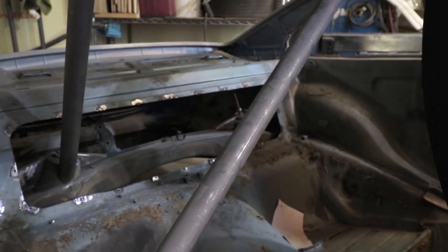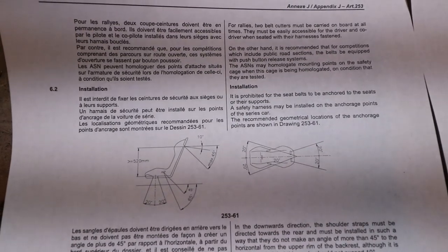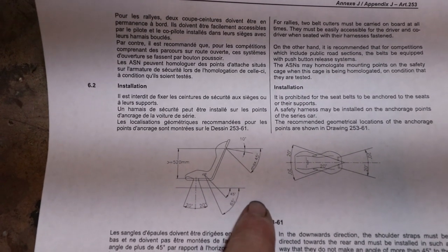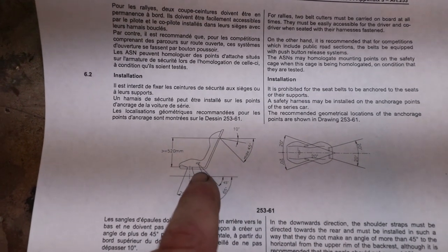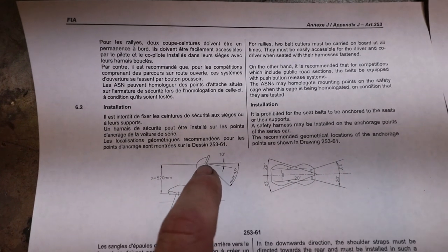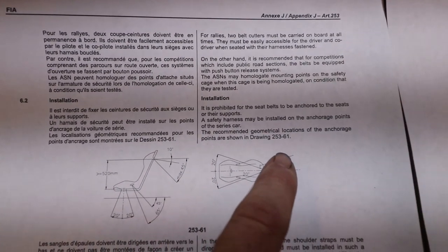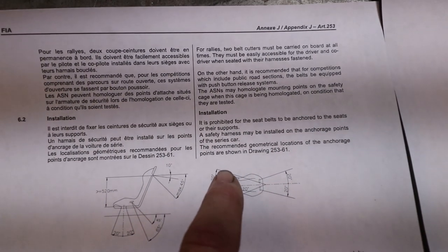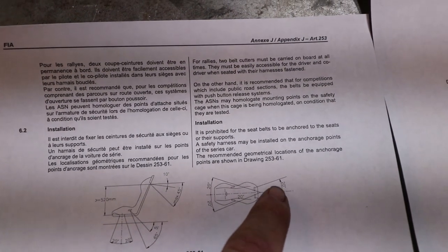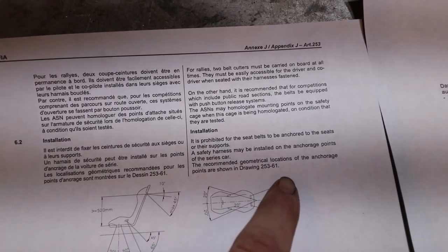So let me show you the rule book again. It's not much of an outlaw or a hot rod if you're always following the rules, right? But I think these do provide some safety guidance. Here's a side view of the seat. They recommend a 10 degree angle of this webbing that goes from the holes in the seat all the way down to the rear of the harness bar. So 10 degrees, and then from the top view, this is kind of where your butt goes. They have no more than 20 degrees from the center line of the seat that the webbing can either go convergent or divergent. They can actually crisscross if you want them to, but no more than 20 degrees.